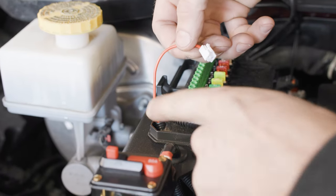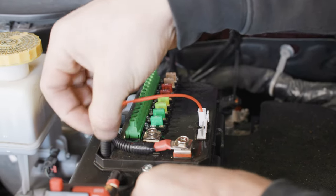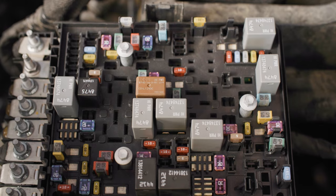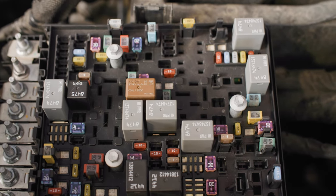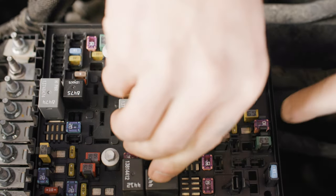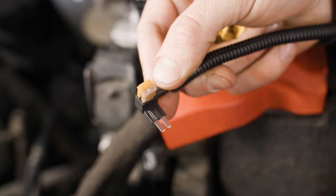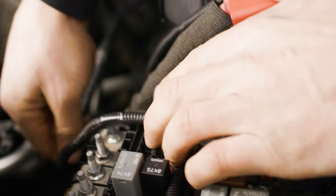Route the accessory wire up through the aux beam switch and attach it to that terminal. Take the fuse tap end, route it down and along the power cable, and up into your fuse box. This accessory wire is a signal cable — it tells your aux beam when to turn on when your vehicle turns on. A good place to tap power for that is spot 37. Grab your fuse remover that's built into your fuse panel, grab that 5-amp fuse, and put it into this piggyback terminal. Take this and put it right back into the same spot you removed it from. Then tidy up the cables.